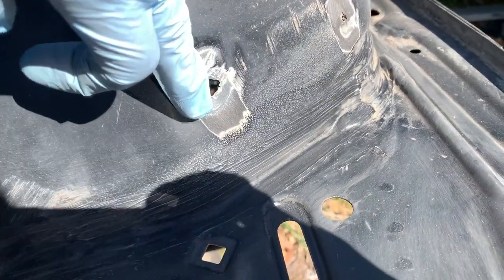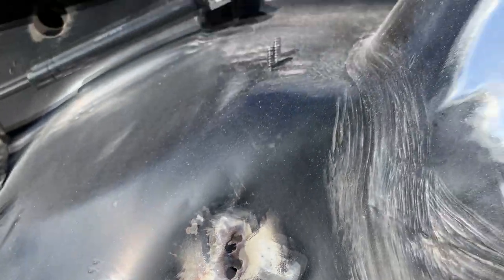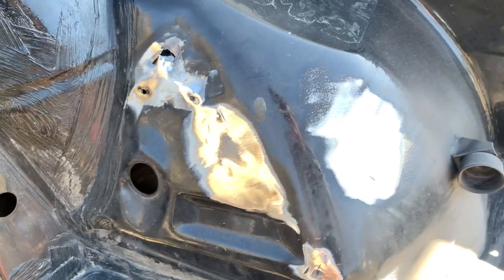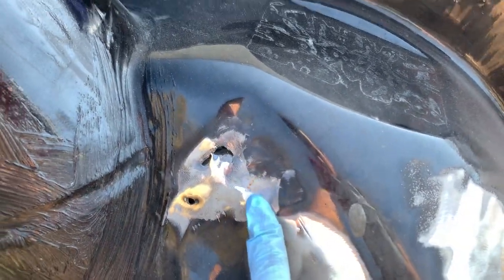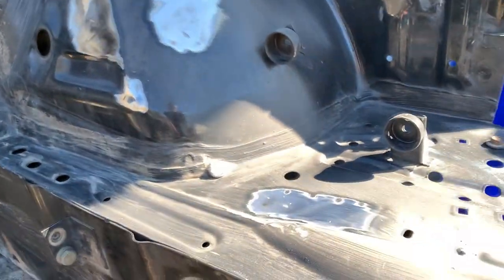And hit these with it so that I can get a nice weld on those, since they need to be bare metal for that. And then the bracket that was up here, I hit it with the flap disc, got all this boxed off and got it good. And then over here on this side, got the big brackets that were there, used the flap disc, got them all down. And over here I can start filling these in with weld, and then I could put some Bondo over it, just a skim layer, and get it all smooth.